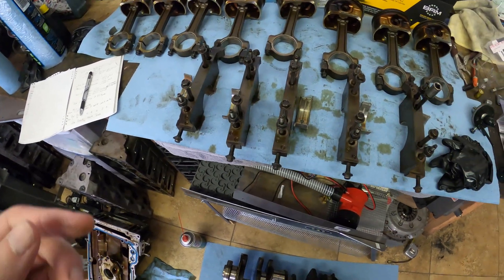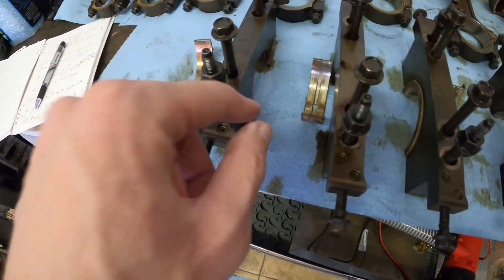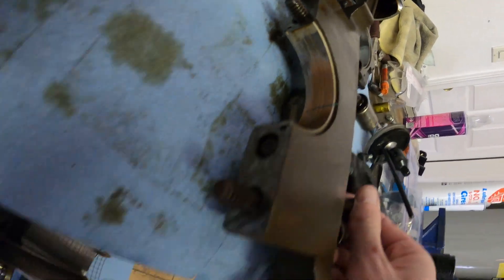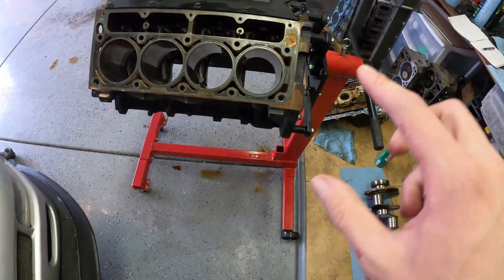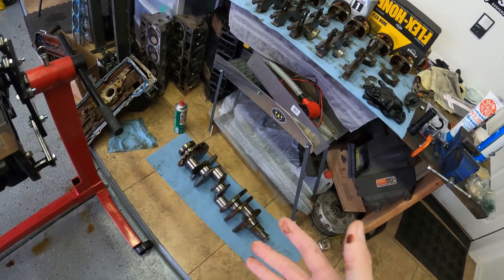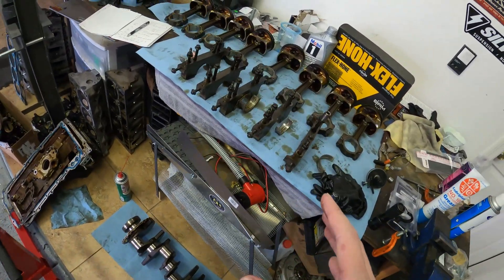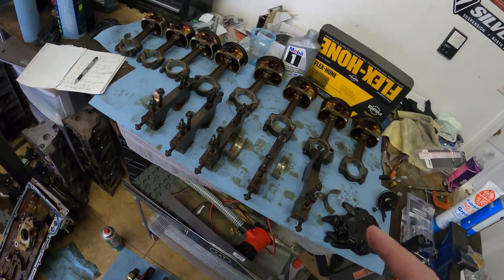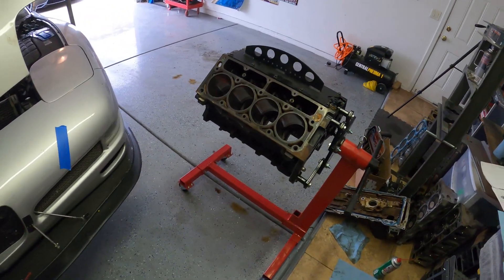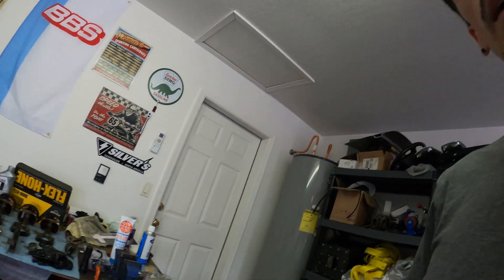The other interesting thing is if you look at the main bearings — looking at the front one, only the side of this one is worn, while others are okay. And a lot of them don't have uniform wear. That would tell me that the bores in the block are out of alignment, or the actual crank is bent, or some of the journals are bad. So I'm probably going to end up bringing this bottom end to the machine shop and having them triple check everything and make sure I'm buying the right bearings. Option two is to take the crank out of this car — it only has about 30,000 miles — throw that crank in this motor and hope that the line hone is actually straight.